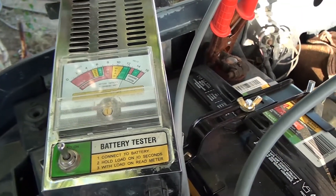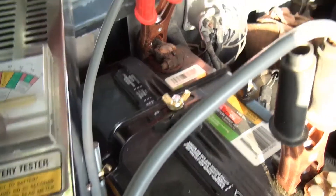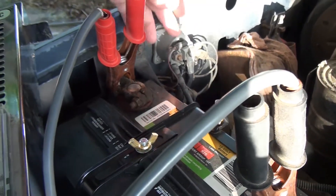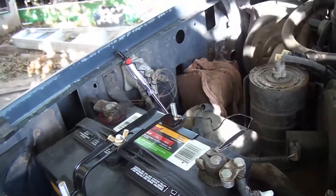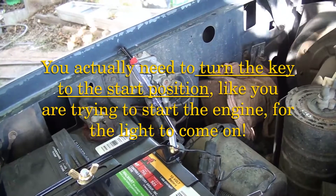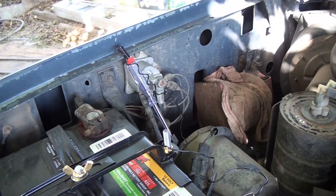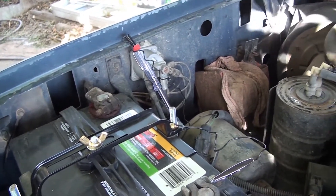So now I've checked my cables and tested my battery — everything so far looks good. The clicking I hear tells me I'm getting power to the wire here. A way to check this wire if you're by yourself is get a test light: one side goes to ground, pull the wire off, stick the other end of the test light in there, and position it so you can see from the cab the light come on. If you don't have a helper, you can take your cell phone, put it on record, set it up out here, and record the outcome to know if you've got power going to the solenoid.